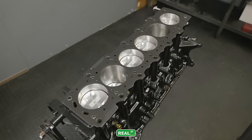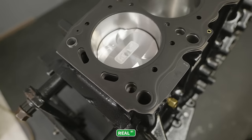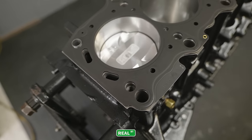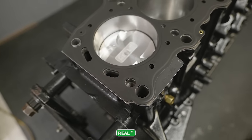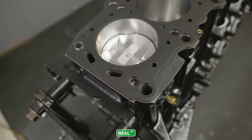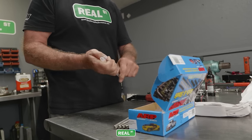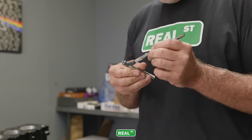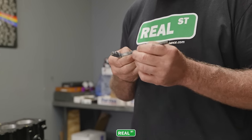If you're installing an OEM head gasket, it's good to look for the tab on the rear exhaust side of the block — this means you have the head gasket on correctly. If you have that tab flipped over, you're going to get oil in the coolant. A couple of times a year I'll be contacted from a customer experiencing that problem, and I'll always tell them to go look for that tab. So when putting the head gasket on the engine, make sure that tab is at the exhaust side rear of the block.